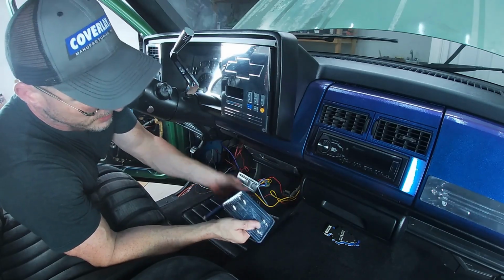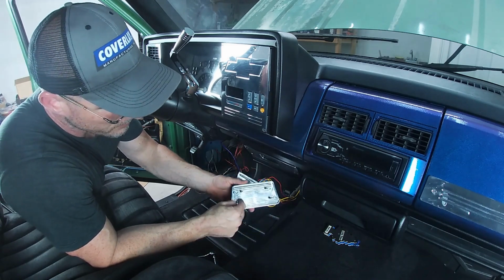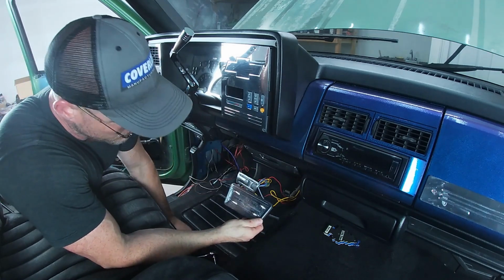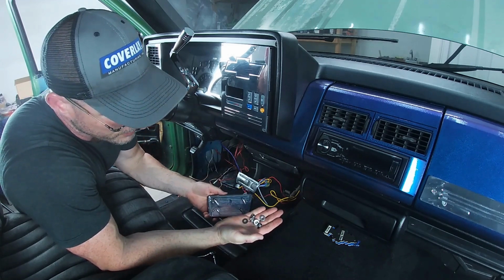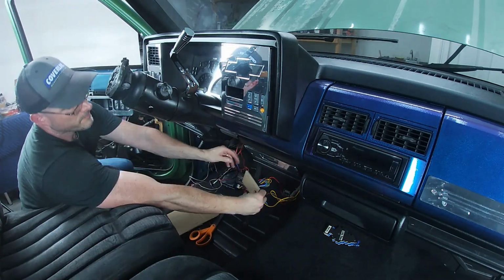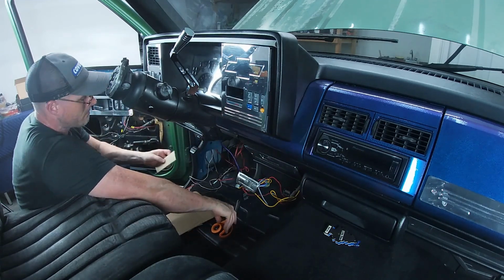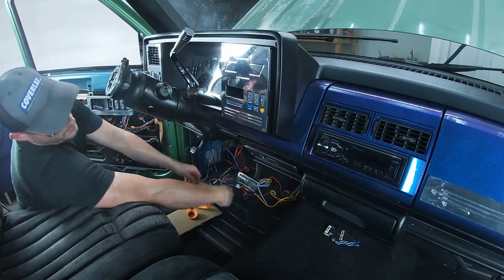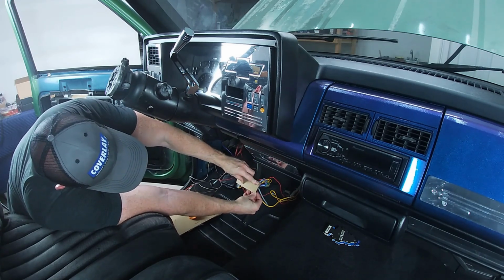All right, so connecting this stuff is pretty self-explanatory. The kit that I have from Billet Specialties, each one of the little threaded bolts go into the inner bolt holes, and I took a little Allen key and tightened each one. Then I'm going to take a washer and a lock nut, put them on the back, locking it to the pedal. There. All right, that'll do.